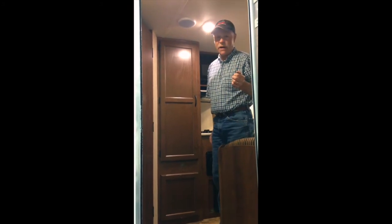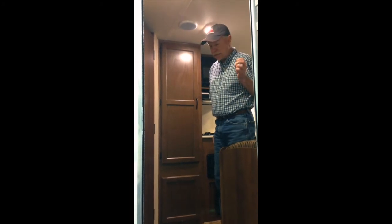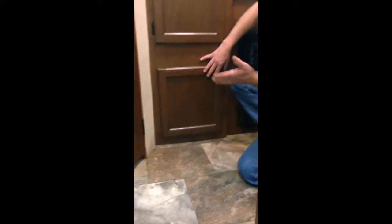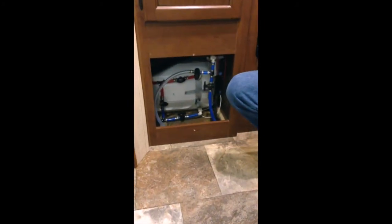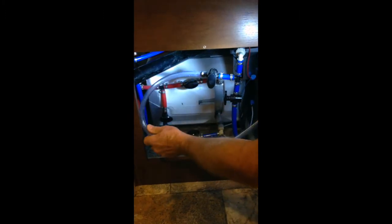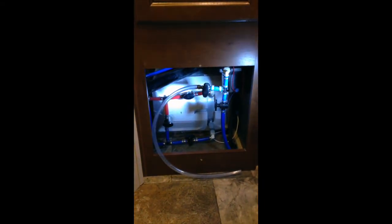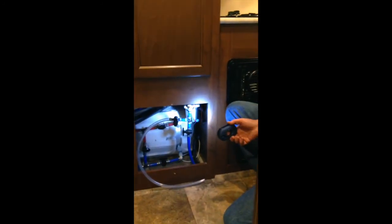When you come inside the trailer, you want to find the back side of your water heater for all your valves. In this case, the water heater and water pump are together. It is behind an access panel usually — it'll look just like a cabinet, except it is screwed into place instead of on hinges. If we take this apart, we can see the back side of our water heater with our winterizing valves, and also our water pump and our pickup hose for the antifreeze. In this case everything's right together, but it may not be in your trailer. The water heater may be in the back, and your water pump will be under the bed or under the sink.